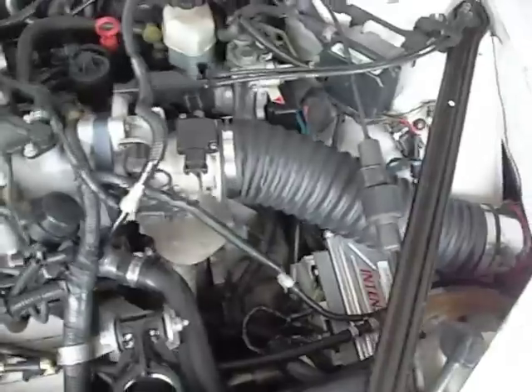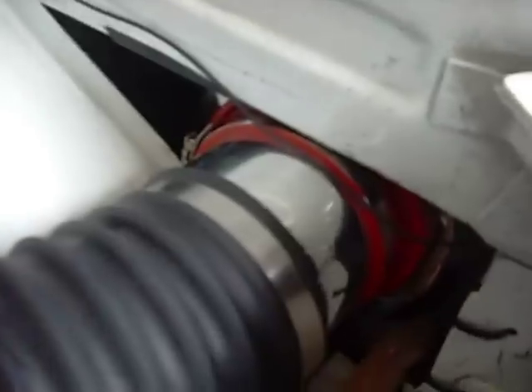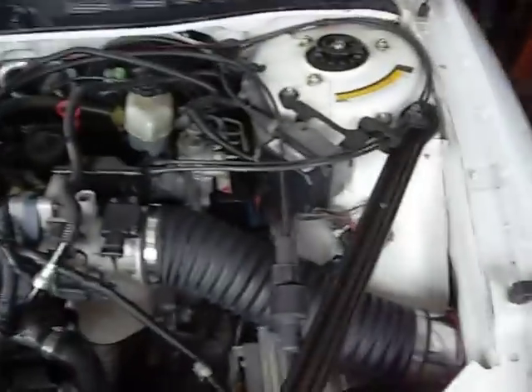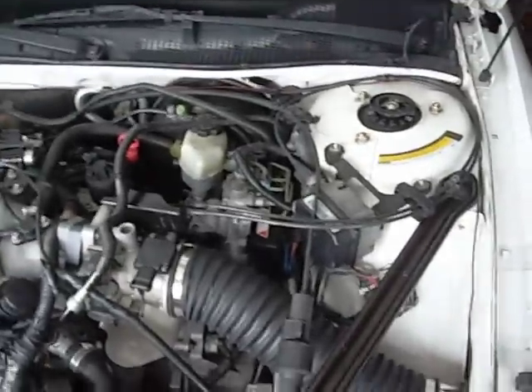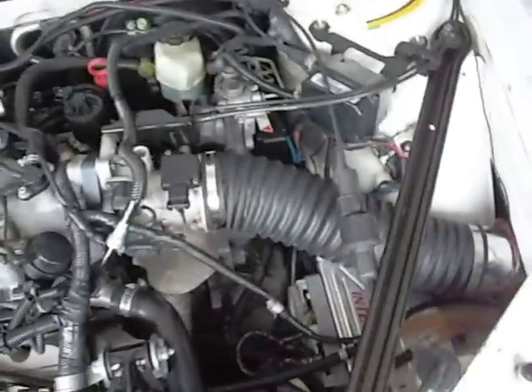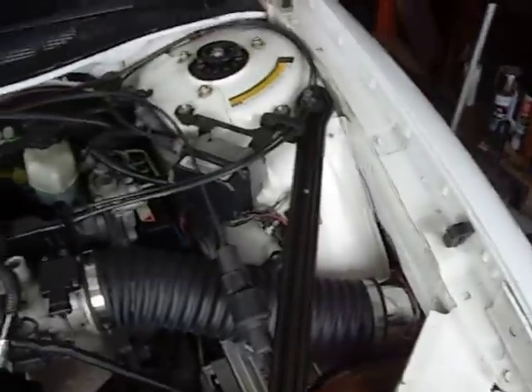The first thing I wanted when I got my car was to hear the supercharger whine. That's very easy to achieve — all you need to do is replace the intake. Mine's a fender well intake. I bought 4-inch tubing, clamped it on the throttle body, and the filter goes right into the fender. On Regals they fit right in — if you pull the front tire out you can just cram it in through here. On Grand Prix's it's a little harder; there's actually a fender brace in there, so you have to cut that before fitting a filter in.